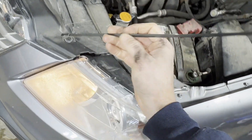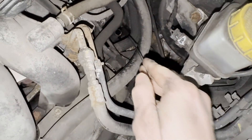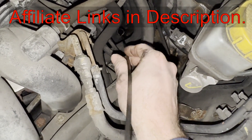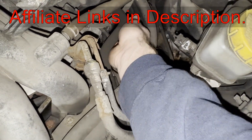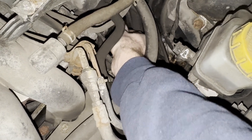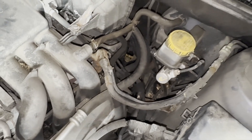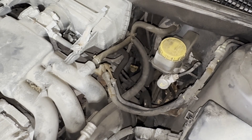And we're all set. But if you needed to add any, you would add transmission fluid right down here in your dipstick tube. You want to add that slowly and a little bit at a time, let it sit for a minute, and then check your level. You don't need to add a whole lot to make big moves on that dipstick.